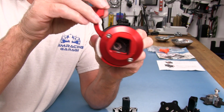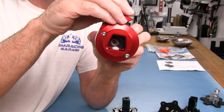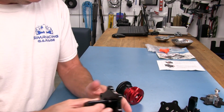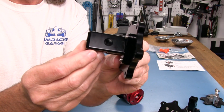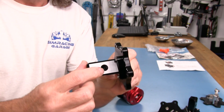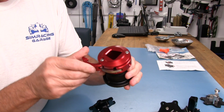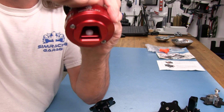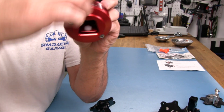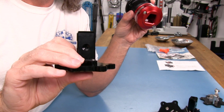And doing that, you can see the nylon inside of there. Try to get a straight shot there, going up at the same time. That piece of nylon is engaging on the bottom that we saw before of this wheel side insert, so it's going up in there and pushing up. Now, when it goes up and seals inside of there and pushes up, I'm assuming that the flat part, you're going to see that, there's a flat plate that this nylon piece is mounted to, and it is also pressing up against the bottom of this insert piece.